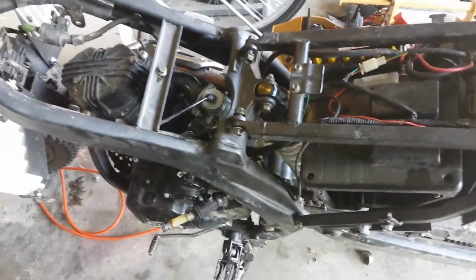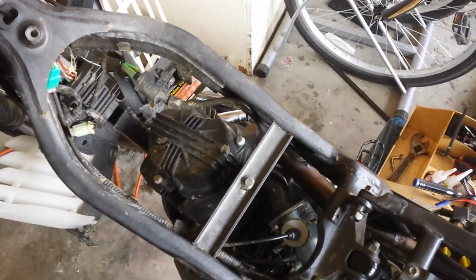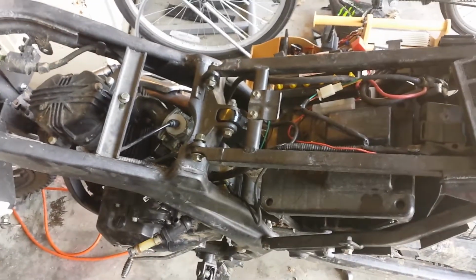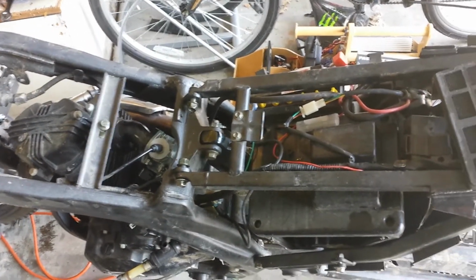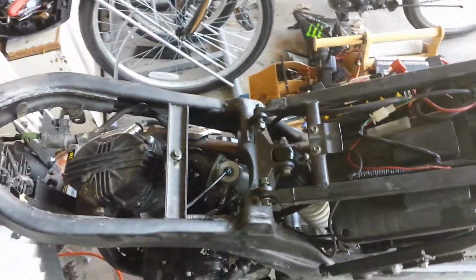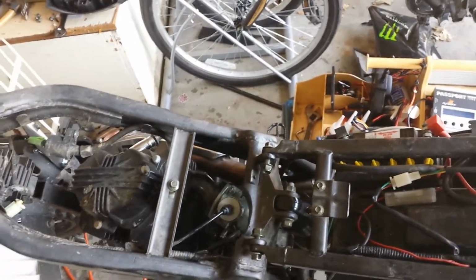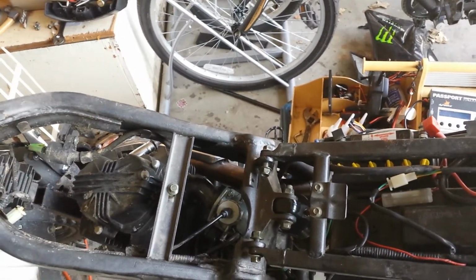Also, if you get this bike new, the first thing you should do is replace the spark plug with an NGK spark plug. Right now I don't have the number for that NGK, but you can look it up fairly easily. The plugs that I have had in all of the other Chinese engines are intermittent at best. Also, one of the other things that I picked up at my local bike shop is a track pack bolt kit. It was about $15, and it has a lot of the common size bolts in here.